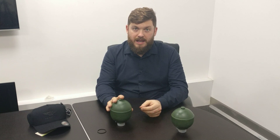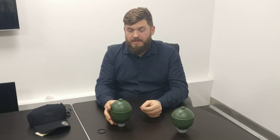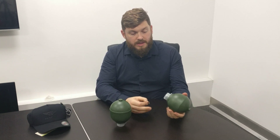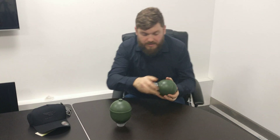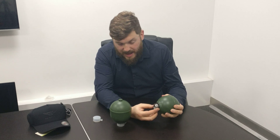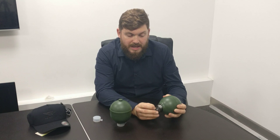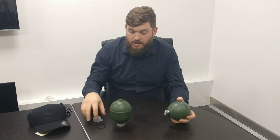There are actually two different types — an early and a late one. They changed them, but you can interchange them; there's no real difference in pressure. It's GMF 1039. Both of these take the same O-ring — they screw in with the same fittings. This sits in a recess inside the valve body. When you fit this, what you risk doing is near the end, that O-ring can just slip out of the recess — it's quite a shallow recess — and then instead of compressing the O-ring, you actually pinch it, and then high pressure fluid is just going to pour out.